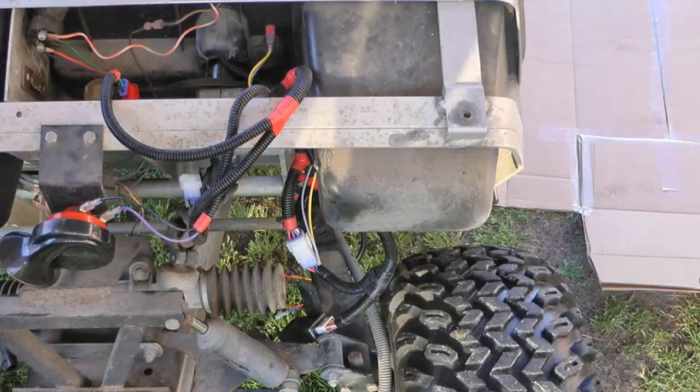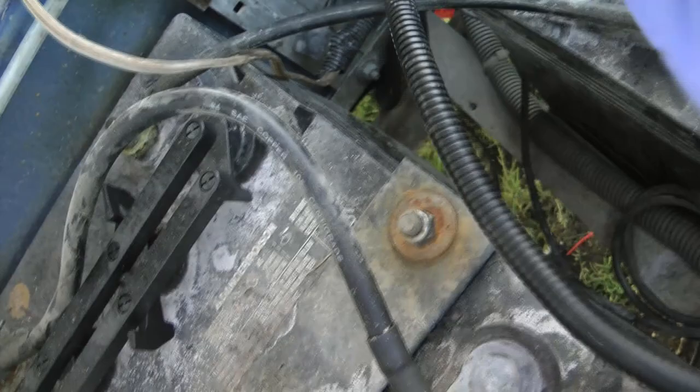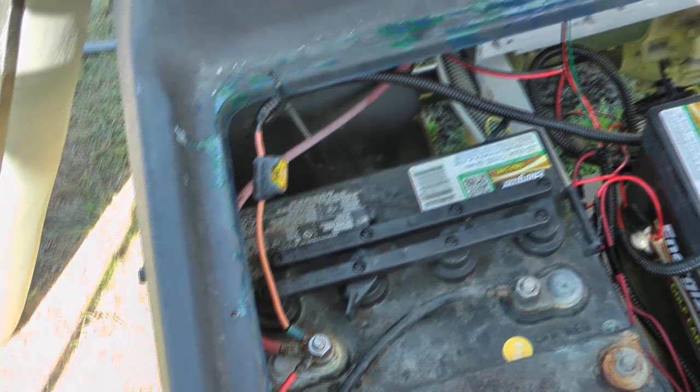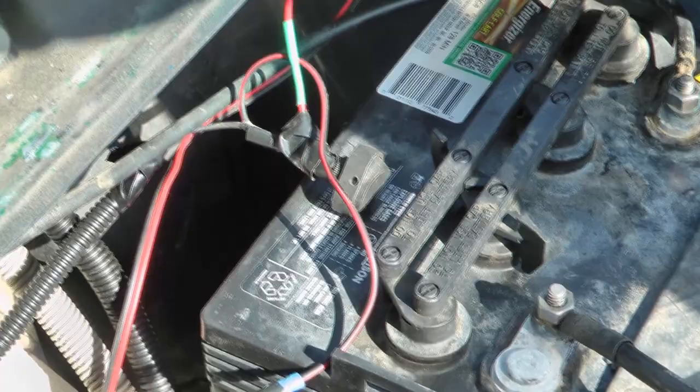There's a gap there, and your brake wires will connect up through there. The rest of the wiring will pass up through there, and the rear ones will head out to the tail lights. You just want to pull them up through — of course they'll get caught on everything, so you'll have to go back and forth. It's a lot easier not holding a camera. You can see the 20-amp fuse there from the hot side. I went overkill — I did a fuse on the negative, and I also did a switch so I can shut it off in a hurry without pulling the cable.